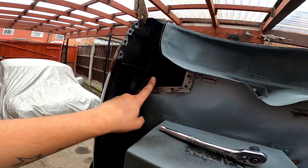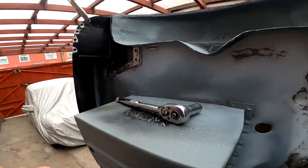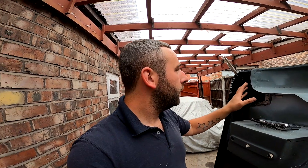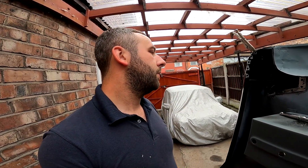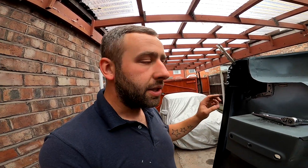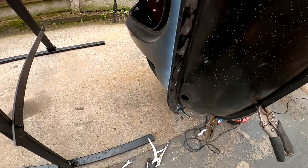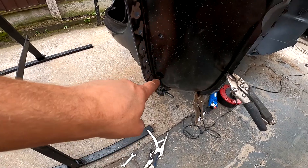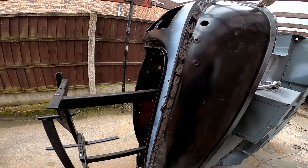Once I've got these on, I'll take the valance off and zinc paint the face of that. All these need to come off again anyway to do the same underneath, put some zinc on it - but I just wanted to know it all went together fine. Now they're clamped up, just going to put some paint on the underside. In this aperture here, this little corner, it's going to get cavity painted. Once these are in their place, I'm going to seam seal in there and get some paint on inside so these corners are all painted. On the passenger side, there's a hole because this valance comes for left and right hand drive cars - I want to keep the fog light holes, so I'll tack weld to get rid of the unwanted holes.